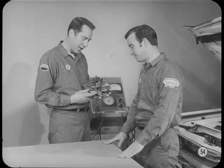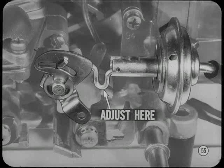That wraps up the AVS four-barrel, Tom. Now let's take a close look at the Holley four-barrel carburetor. I think we can find some pretty important things to review. The vacuum kick unit may look slightly different, but works the same as the AVS kick unit. Any adjustments are also made at the loop in the vacuum kick link. The specs are not the same, so check your service manual when setting the vacuum kick.